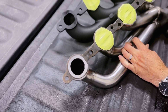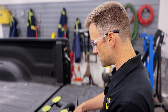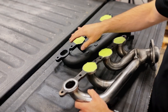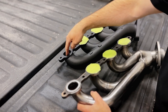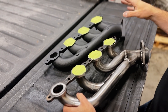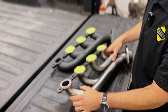The rest of these ports look all the same underneath the tape. Without any other details to discuss, we can move over to the flow bench and show you what we're talking about in terms of performance. Long-winded recap aside, the main benefits you're going to get from sticking with the cast manifold are: reliability with heating and cooling because of the uniform thicknesses and lack of welded joints, better port matching than tubular style, and the third being flow performance — where in the case of a shorty header, you can actually be better with a cast manifold than with this crunched up tubing. Let's go to the flow bench and take a look.